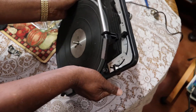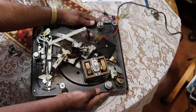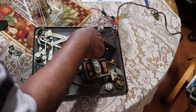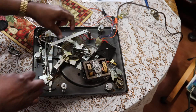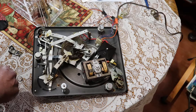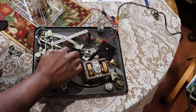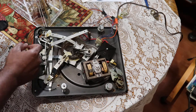Let's take a look at it. I'm going to flip it over to the other side. Now, looking at the other side, I can see that there's a lot of old grease in this cam right here — this plastic piece right here. And all these little channels where these mechanisms slide through, there's a lot of grease in there. They use grease in the beginning, but as it gets old it gets gummy and stiff, so it causes the mechanisms to move slower.